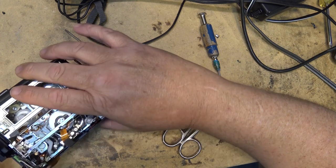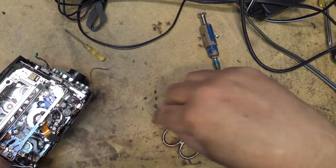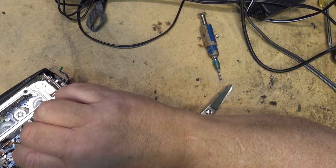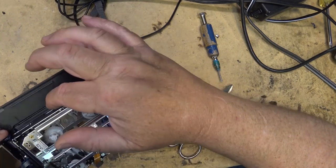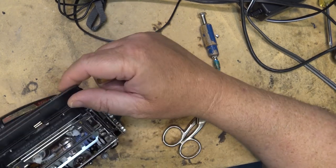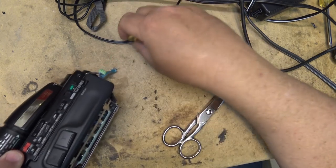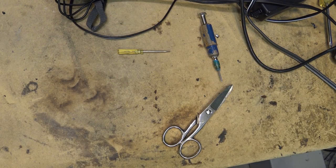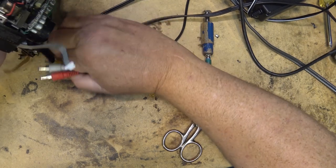It's not worth putting any more time or effort into this. I'm not going to even consider fixing the lens because I don't know where the fault is — whether it's the actual lens itself that's jammed or the ribbon connector. Quite often the little connector here broke, which is very common on these because it's always being flexed when people open and close it. This was a very common failure and then you lose your zoom. It's either that or the lens itself is frozen. But at this stage of the game, that's not going to be addressed.